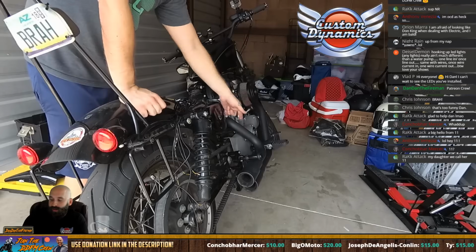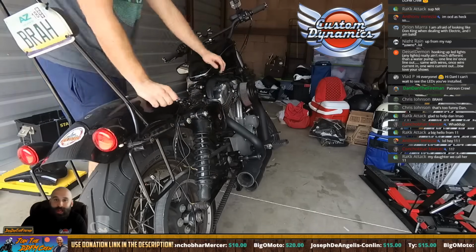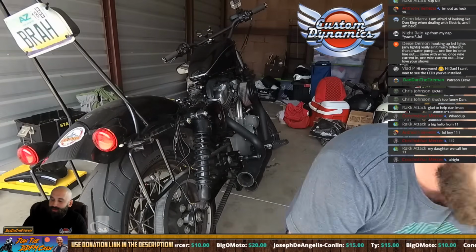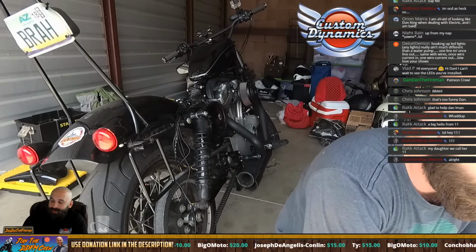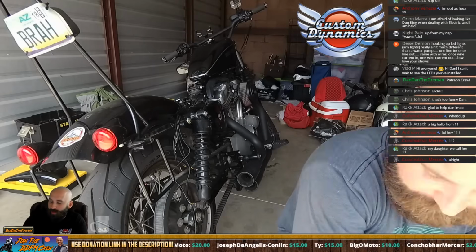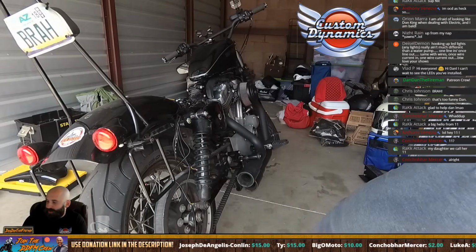So he asked me if I had a circuit tester. I didn't have one. So that's going to be another thing, that you might want to have that as a tool. This not only tells us the LEDs are operational, but that the BM Remote 4 is sending 12 volt on the white wire, therefore the fuse is good. And the fuses were good. I was able to check that.